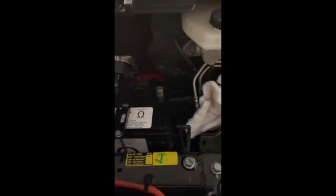Next up, I'm going to reconnect the positive terminal, then connect the high voltage connector, and then come back and do the negative — the ground. Positive is connected up and tightened down. Negative is still waiting. Let's go over and connect the high voltage terminal. We're just going to slide this on here, push it down, and pull the clip up — and it is tight and in place. Come back over to the front, connect the negative battery terminal, and then we'll put this back together and see what we got.